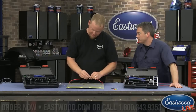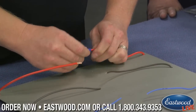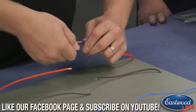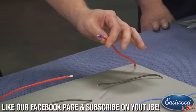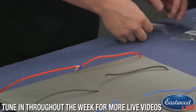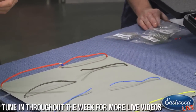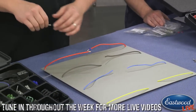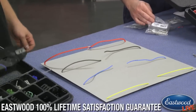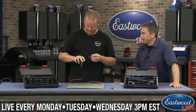So what you're going to do is just slide that on first. With the bigger wire it is a little more difficult — you just get it back and then have the wire stick out right there in the front. So you have your weather seal on now. Next we grab the correct bag of terminals. You can see all these bags here. For this kit, if you run out we do offer replacement kits, or if you're doing an entire harness where you're going to be using a ton of these, it comes with a lot of connectors right from the start.